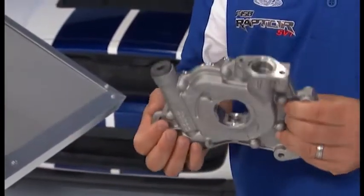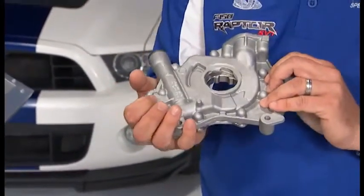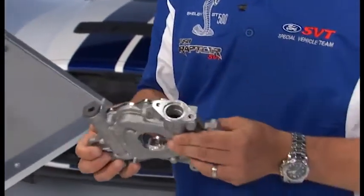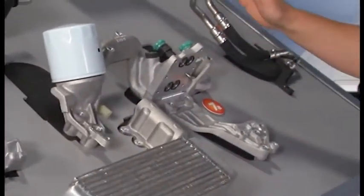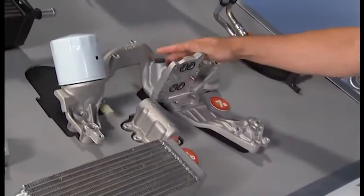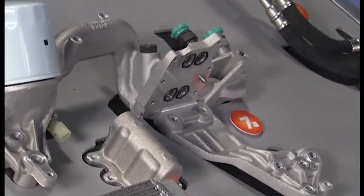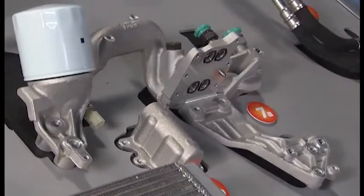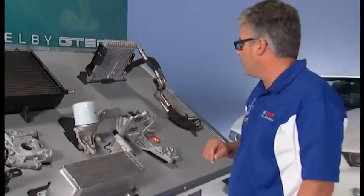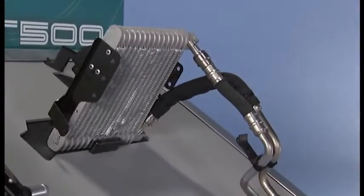Another system that is standard on the car is the engine oiling system. This is the oil pump. We increased the flow capacity on the part in order to supply the piston oil squirters which were added to keep the pistons cool under the extreme operating conditions that we see at 662 horsepower. That oil is routed out to an oil filter adapter assembly. On the base car, mounted to this pad would be a water to oil heat exchanger that would take heat from the oil, put it into the coolant, and then reject it to ambient air via the radiator on the car. This system also routes the oil through the oil filter, and on the optional track cooling package it will run oil out to this part which is the standalone engine oil cooler.